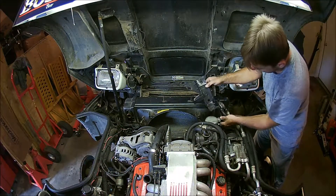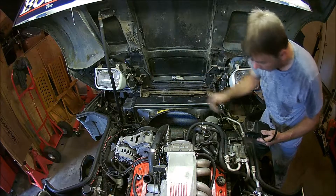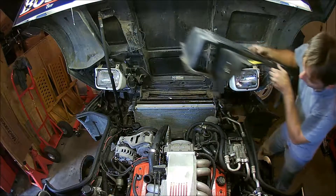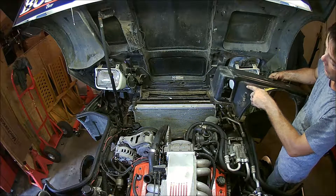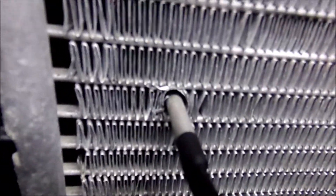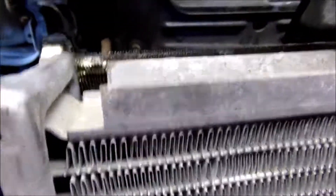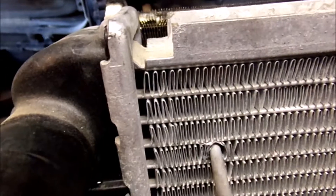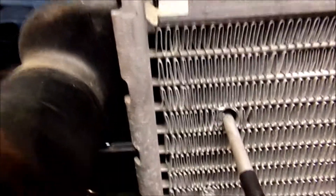The shroud here was attached for the AC piece. This is going to be a good location — it has to come off. There are some big ones on each side and some small ones across the top, but the top part should just lift right off. We'll keep it close by because we're going to run a wire through here. You can see my mounting position — I went between the cores. You can see the thin little cores, and this was not easy. You have to be real careful, and I hope I did not puncture a core in the radiator.